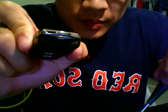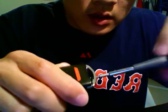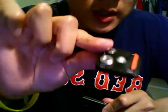Okay, so you're going to take the 1/16, and there's going to be a screw on the back. Don't know if you can really see it that well. You're going to take this one off. The screw comes out like so. It needs a couple more turns. So the screw comes out. And here's the faceplate. That's separate like that. And here's the actual transmitter.